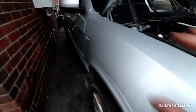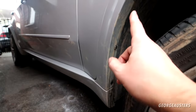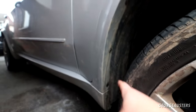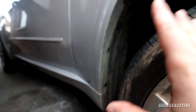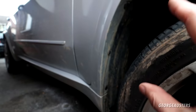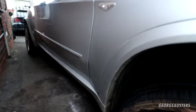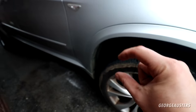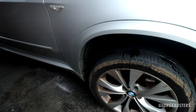For those of you who don't know, the washer fluid reservoir is located behind this wheel arch liner here, and it is a massive pain to get to. Usually you would just pop the wheel arch liner out and access it that way, but there's really not a whole lot of access on these X5s. You end up having to take the side skirt off, pop the wing out, take the wheel off, get it all up in the air — and that's how you can physically access the small screen filters on the end of the pumps.